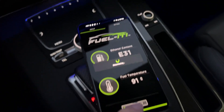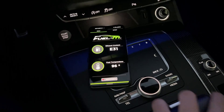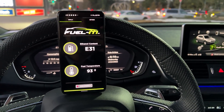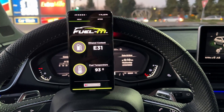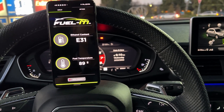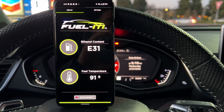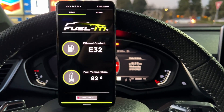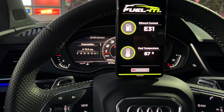Refreshing the ethanol content sensor — still at E31 at the sensor's reading point, so the E85 I just put in has not made it to the sensor yet. As an exercise, I'll idle the car and we'll see how long it takes for the ethanol content to start to rise. Once it starts to rise at a considerable rate, I'll know we're getting close. Around E40 to E50 while idling, I'll shut it down and flash the E85 file. Right now it's flickering around E31 to E32.